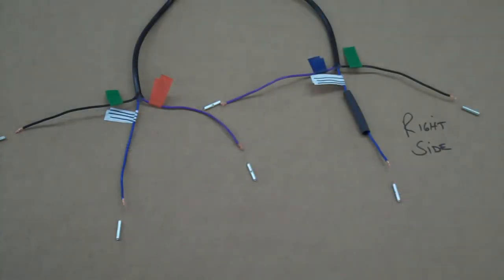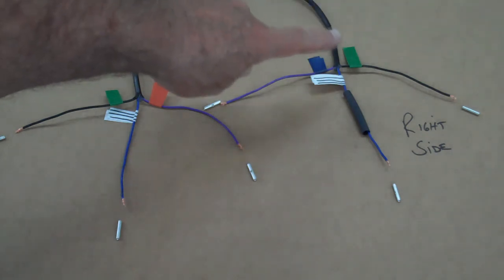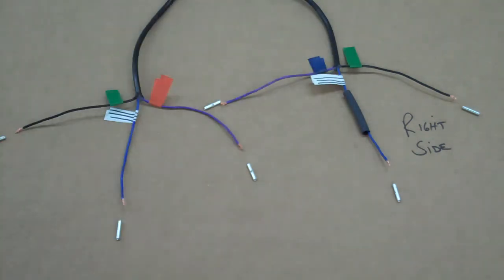Okay, let's go ahead and follow the main wiring video. I'll show you how to take the lights out of the stock light bar. If you'll notice on the main video, I think I show you how to cut the wires off at about 9 or 10 inches or something like that. But anyway, because these wires are so much longer coming out of these lights, just go ahead and cut those wires off about 4 inches.